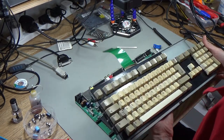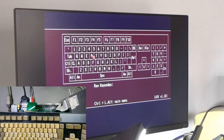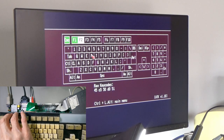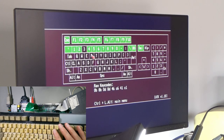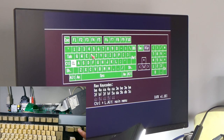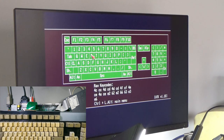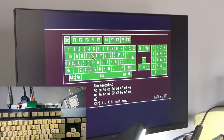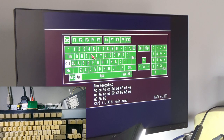It's going to be tricky to get in — I'm not sure how I'm going to prop this up without destroying something. Maybe I'll just have to hold it. Oh, we've got something! So the keyboard is back. I've had problems before where if you press two keys together the whole keyboard looks like it's working but some key combos don't work. I've had it where Control-Amiga-Amiga didn't work, but it is working. So I think I've reconnected that correctly.